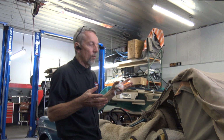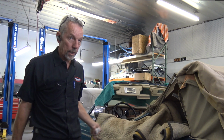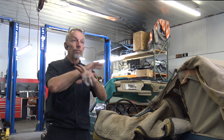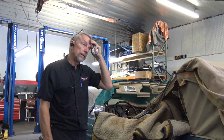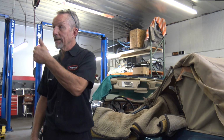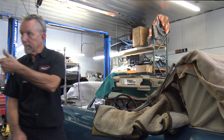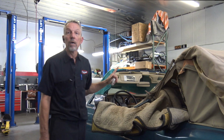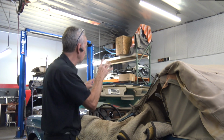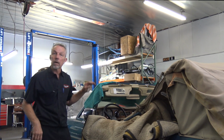So what that means is you've got to have a lot of hydraulic lines, a lot of limit switches, position switches, and you need a computer to run it all. That is the biggest problem with the Corniche 4 and Corniche S, and Azure, right? And the Bentley version of that, the Bentley Azure, and then the later Corniche and Bentley Continental GTs, all because people wanted one touch. It's too much work to disconnect this latch. I might break a nail.